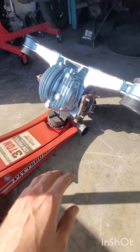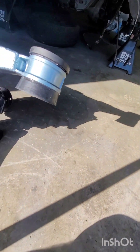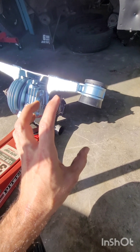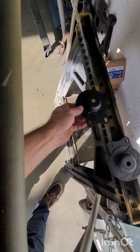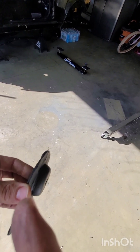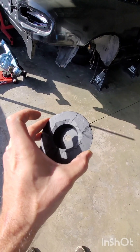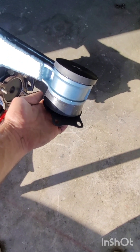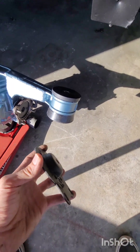I'll be guiding the diff along with the jack, slowly putting it up. Make sure you have the bolts you need and that little mounting piece that goes on the bottom. The stock mounts have rubber pieces — actually a bunch of little triangular ones — that you have to burn off and remove, plus one on the back. They're used for vibration dampening. If you're going with upgraded bushings you need to remove all those triangular ones; if you're keeping stock you can just leave them.